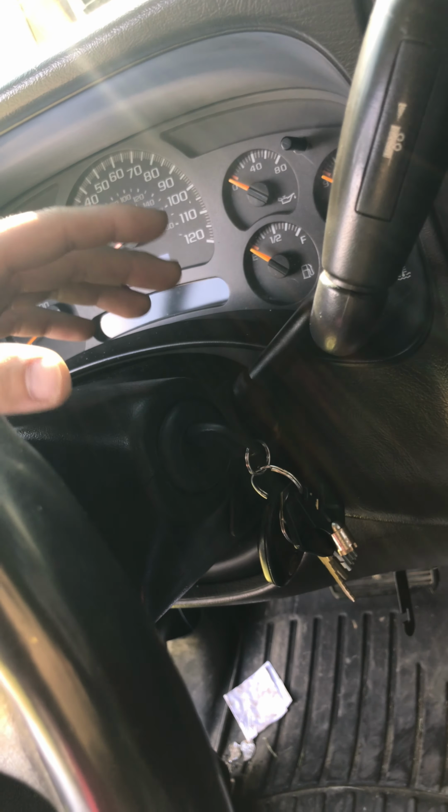And then the next hardest thing is right here. I don't know if you can see real good up in there. This is where, if it was factory, these holes right here is where the clutch pedal bolts to. And on a factory 5-speed truck, there's another cross member up there that it bolts to. Usually I just cut that top mounting portion off of the pedal itself, and I stick nuts back through here with a piece of welding wire, and drop them back down in here over this hole, and then put a bolt in there to hold them still until I can get the pedal in.